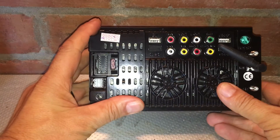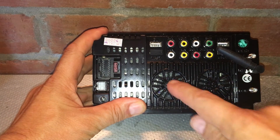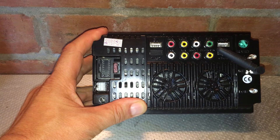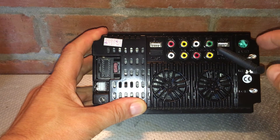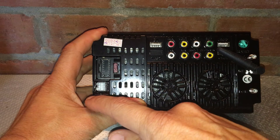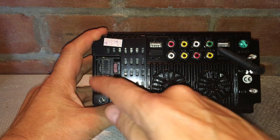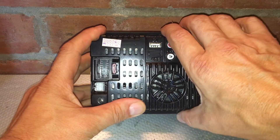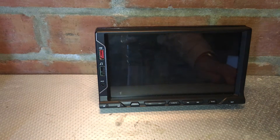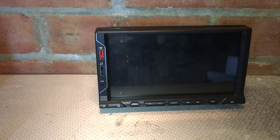On the plus side it has got lots of connections on the back. One of the reasons I went for this particular unit is it looked like it had a couple of cooling fans on the back, but as it turns out these are fake vents. We've got GPS antenna, DAB antenna, normal antenna, lots of USB ports, an additional port for CAN network, the standard connection, and all of the speaker outlets. The problem is that none of the USB ports seem to detect anything being connected.